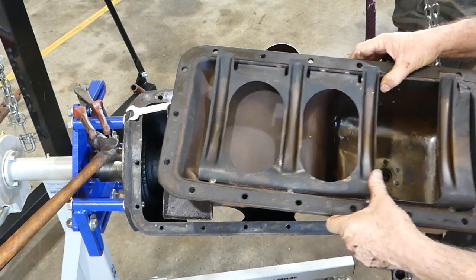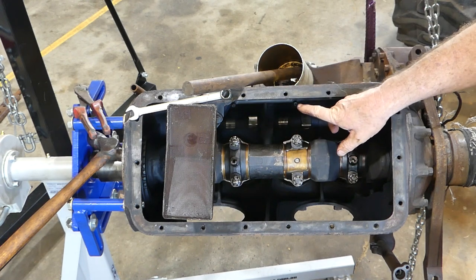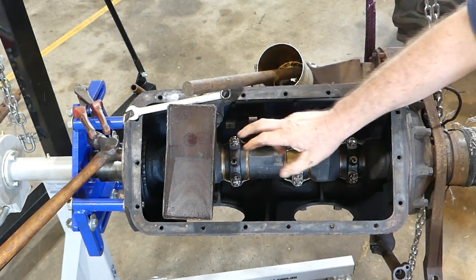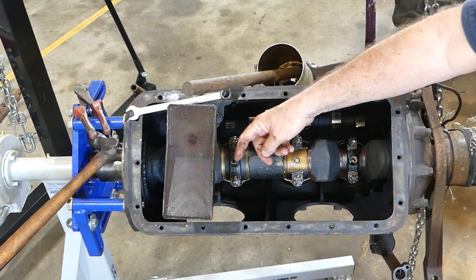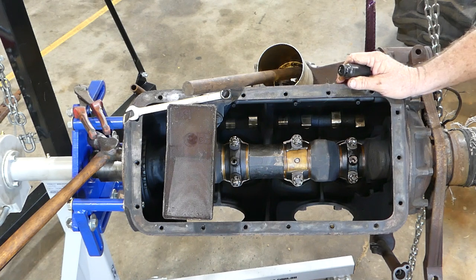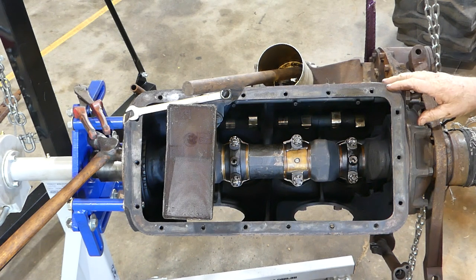Now these get oil from, we have an oil pump here and we have an oil manifold here, and in line with each one of these is an oil squirter. So the oil pump picks up the oil, puts it out through this manifold, squirts it into these little trays, and then the crank comes down and dips into it. So a lot of the old vintage machinery or stationary engines did this sort of thing. But look, just for the moment, I'd like to get the number two out, and we'll have a good look at this rod, I think, and just see.